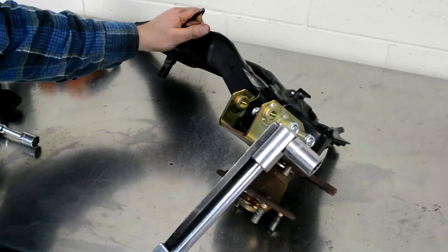The fans are set up on a relay. I also have a Mishimoto oil cooler with dash-12 lines, mounted behind the front bumper. The oil cooler has a fan and is being held up by the Mayhem front bumper support.